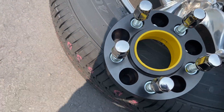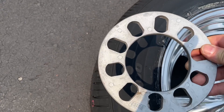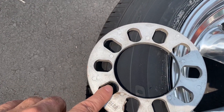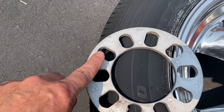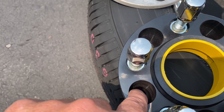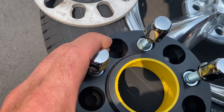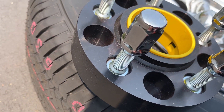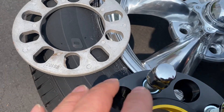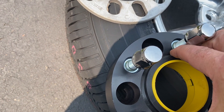These are superior to the spacer that was in there before, because the old ones just kind of floated in there — nothing centering the tire other than the lug nuts going through the holes. With these, the lug nuts come in here and you put an acorn nut to hold them, and then they have studs that come out to hold the tire on.